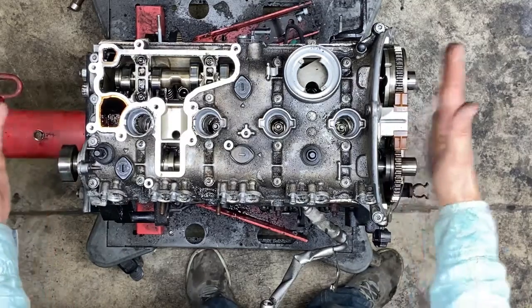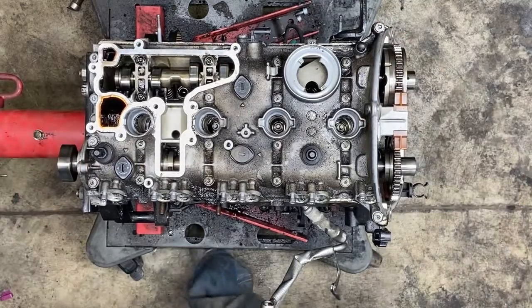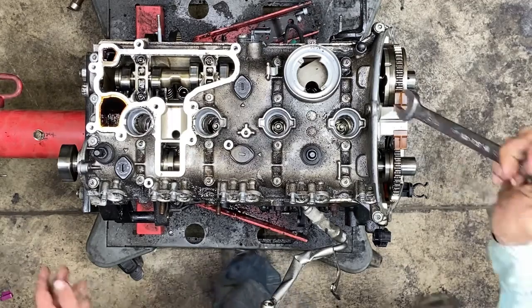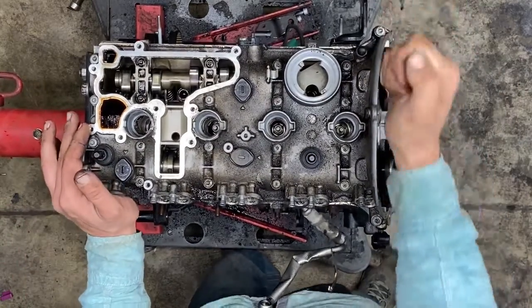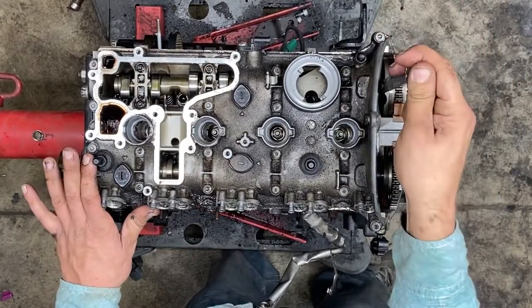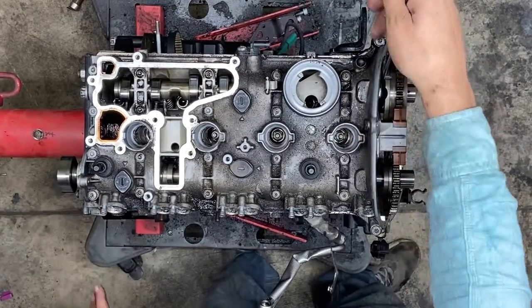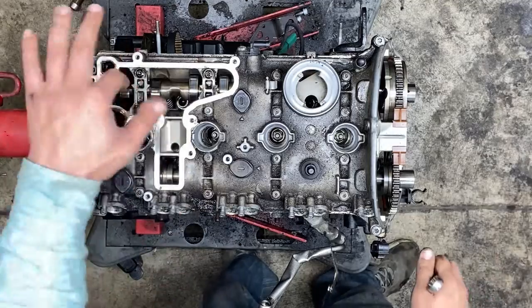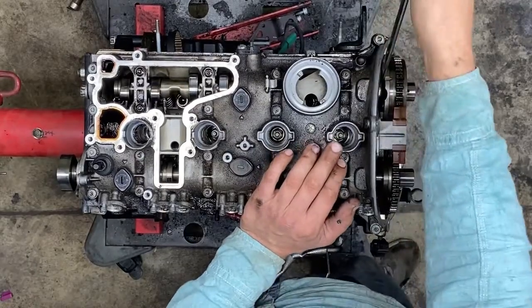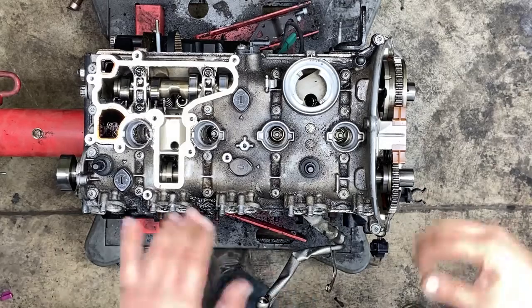When you're done, do like that with your cam. Make sure that your cams spin. I like to take my 18mm — always, after you're done with this, at least on the intake cam — I like to take my 18mm and do like this, and if you can't pull this cam back and it springs back, something's bound up, something's wrong. Something's over-tightened, something's in the journal bearings, something's screwed. If both of the cams don't have a nice spring like that, they should be completely free.